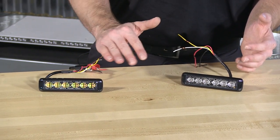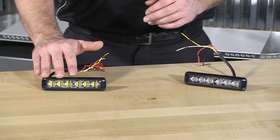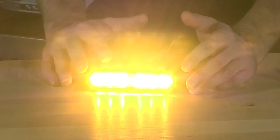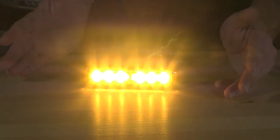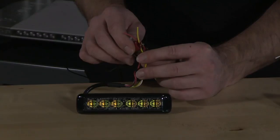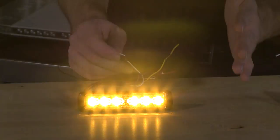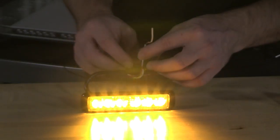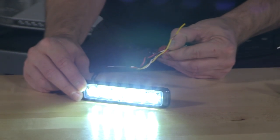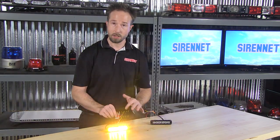So we'll go ahead now and turn on the dual color surface mount Micropulse Ultra so you can get an idea of how they can function for you. This one happens to be an amber/white. When the light head is on and flashing away, this one has been set to just isolate the amber for the cautionary mode. If I take the yellow trigger wire, momentarily applying it to a positive 12 volts, that will advance the flash pattern of the light head — they're synchronizable as well. When it comes to the secondary function, we have a white trigger wire that can be used. When it is applied to a positive 12 volts, in this case it has been set to activate the white as a steady burn. The white trigger wire can also be activated without power applied to the cautionary trigger.